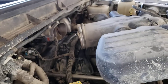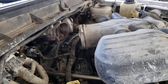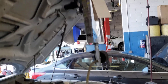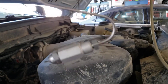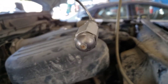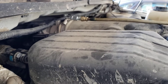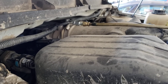Jay's put the throttle body back on. Now I'm going to show you how to put this tool in. What we have here with this tool is a bottle that we can put our chemical in. It comes down here and this will go in and sit in the throttle body so that it can spray into the intake manifold itself. That sits up in there like that, into the throttle body so that it can spray into the intake manifold.